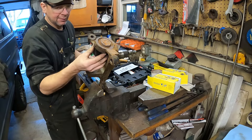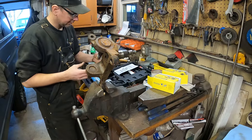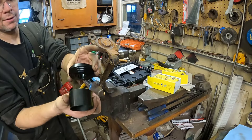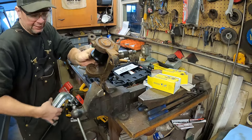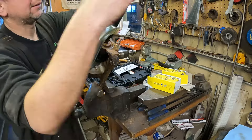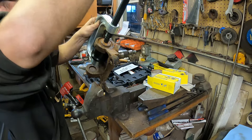The kit comes with lots of spacers. That's going to work there. I need a spacer — this will fit over the ball joint. I'm going to stack this adapter up under here, go over the ball joint, and press into the cup. I'll hang the tool on it like this and drive right down into the center of the ball joint. I've got a 7/8 socket and a ratchet. I'm going to spin this around so it's using the knuckle to hold itself.